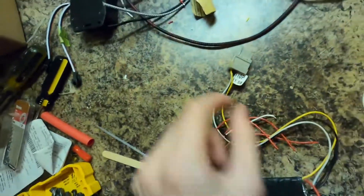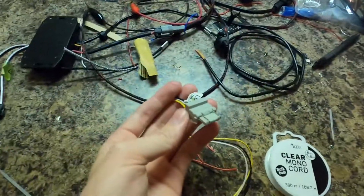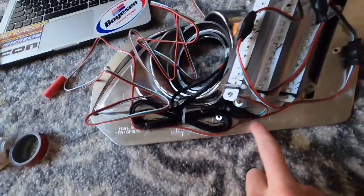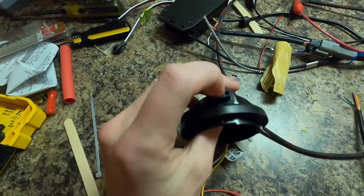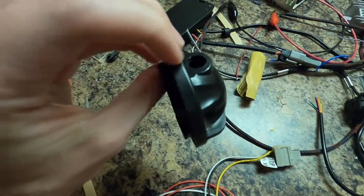This connector is what came off the car - I'll use this to connect to the left and right turn signals. It plugs into a bulb connector and twists and seals in. I might take that turn signal bulb out, seal it up, and make the LED come out the other hole. Right now it's wired to go out that hole, but I could try to make it go out the top hole and then out the bottom there, which would be a much smaller hole and pointing down. The LED lead won't fit through those two holes but it'll fit out that other hole, which would be a lot easier to tape up than the blinker hole.